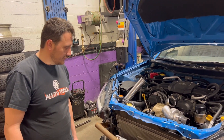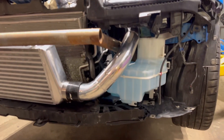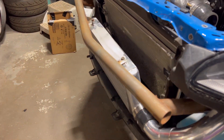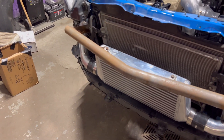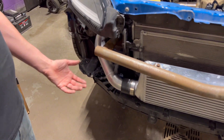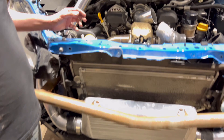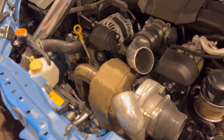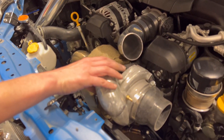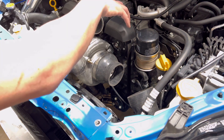So we're in the middle of building the intercooler piping for this thing. We've got the intercooler mounted here, mounted to the crash bar I made. This has been on the car for a little while so it's a little rusty — we'll be selling them painted and coated. The intercooler pipes come up under the headlights. We're still going to build the top pipes. This pipe is going to come over into the compressor outlet, the throttle body is going to come into this pipe over here, and we'll have a MAF sensor there.